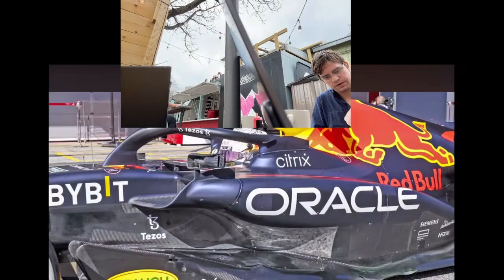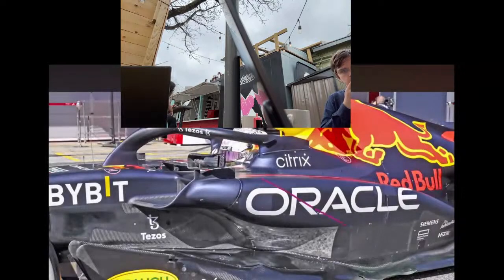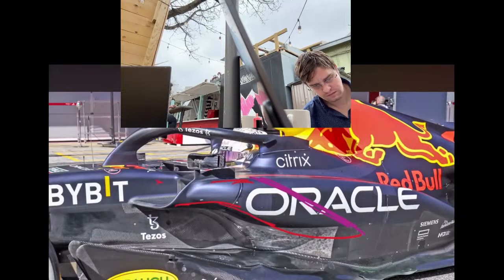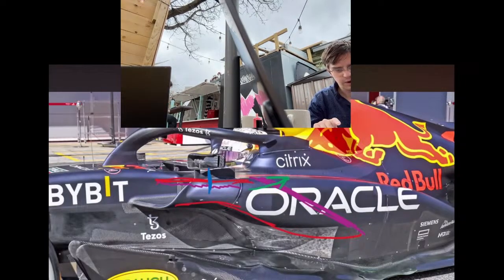While I couldn't possibly know exactly what they're doing with it, I have a few reasonable guesses. The first one is that it could be to reduce the duct losses. So obviously in the side pod we have a radiator here. The primary intent of the inlet on the side pod is of course to provide cooling to the radiator. And then running through the side pod we'll obviously have some form of ducting that will go down to the radiator. Now if you have your inlet sit all the way at the front along there, then it's just going to be generating a boundary layer and losses the whole way along it, right? So if you were to cut this particular portion of internal ducting off from there forwards, you would reduce the losses coming into the system. This means you get more flow across the radiator, you would get better cooling. So that's a positive thing. This is probably the most minor detail of the reasons that I've got to list.